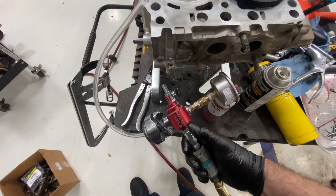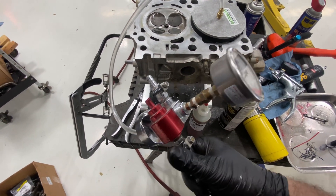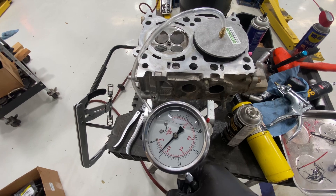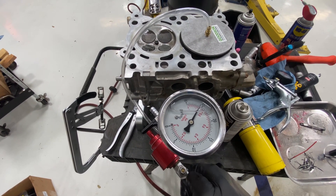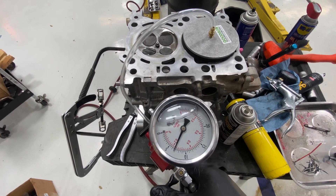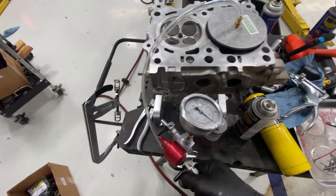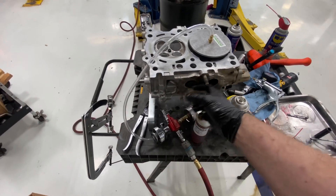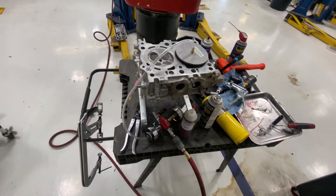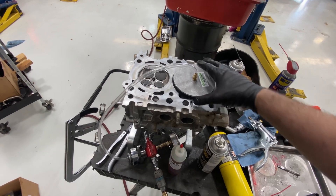This is an airlift I use for cooling systems. An airlift is nothing more than that $600 gun that Goodson sells — I just rammed that hose up in there. Use what you got, folks. Running 90 PSI shop air on this gadget. Perfect. If I really wanted to get super accurate, then I would be taping all this up, but like I said, we're not building hot rods here. This passes for an economy car.